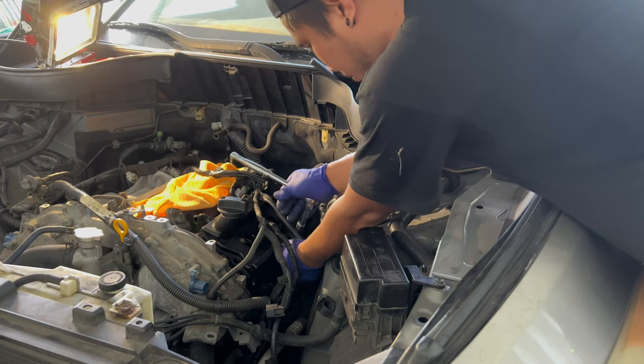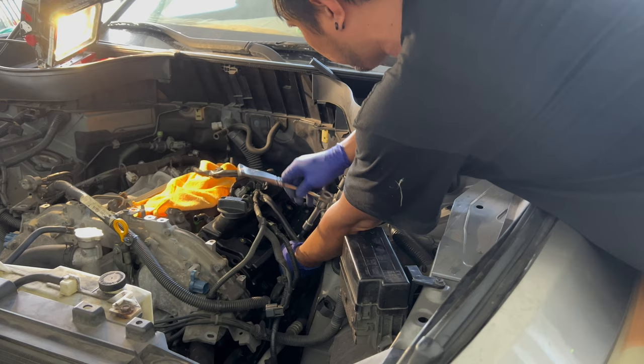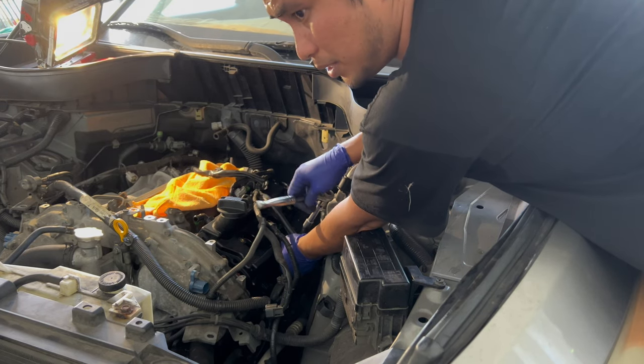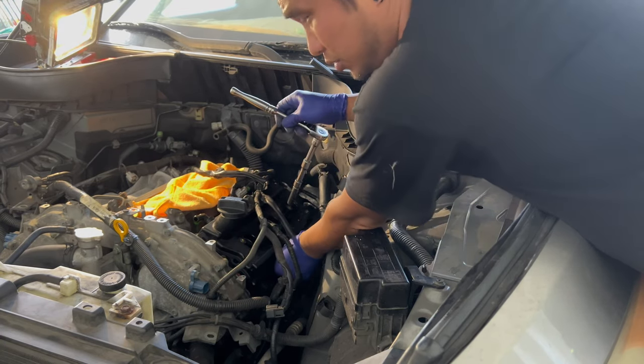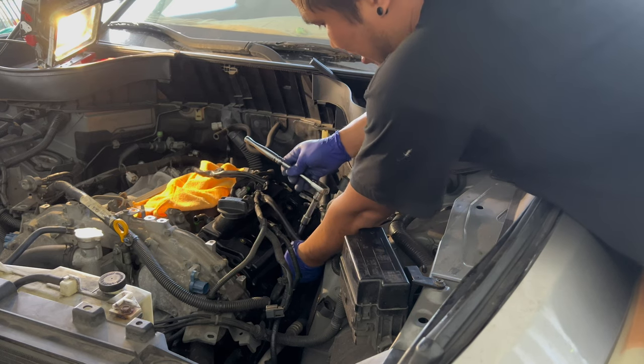I think this is a coolant hose — it's going to be a problem for you. Also, while you're here, you can clean out the intake manifold area where it's going to connect. We got the JB Weld red silicone high-temp RTV. What they like to do is put it on all the curves or the galleys of the valve cover. Some people also like to put a very little dab throughout and follow whatever curves or turns there are, because that's where the seal kind of comes apart. So these are the old seals — I got the new seals over there. I'm going to install the new seals, dry them off, and then put a little more RTV on the corners when we install it back onto the engine.